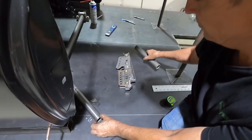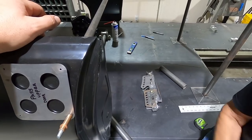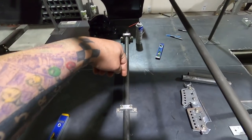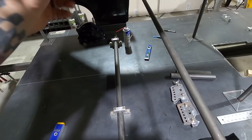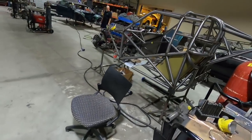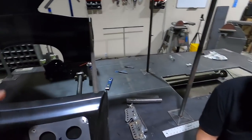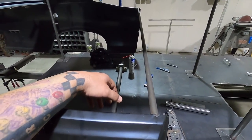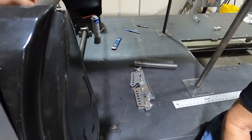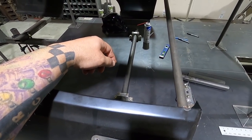Basically that 10-inch mark is the setback of the funny car cage, because that'll be the main hoop. There are a lot of different ways to do this — you could do the rear cross member straight and your main hoop in front with the whole funny car cage ahead of it, or split it in the middle. I really like the front hoop design best, especially on a pro mod style car. The 10 inches is the setback, and now he's got all the width figured out.